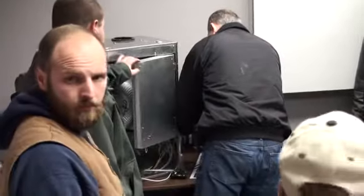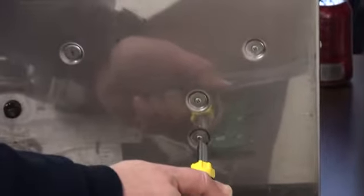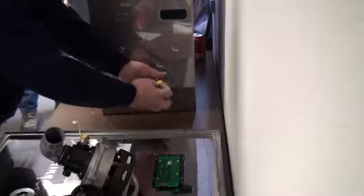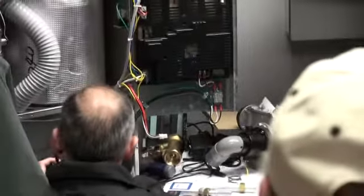There's two Phillips head screws. Pull the two Phillips. Once the sparker drops, just grab the black wire that comes off there and pull it off the burner. Just go ahead and unplug the wires off it - these two. Okay, everybody got that sparker off?